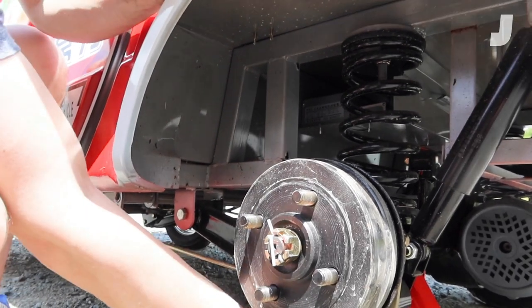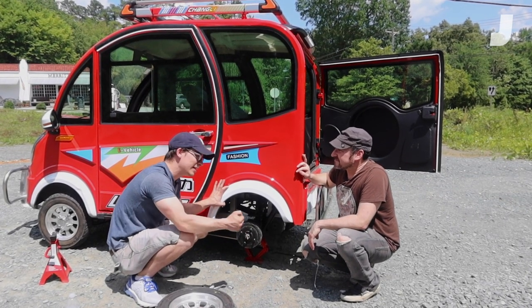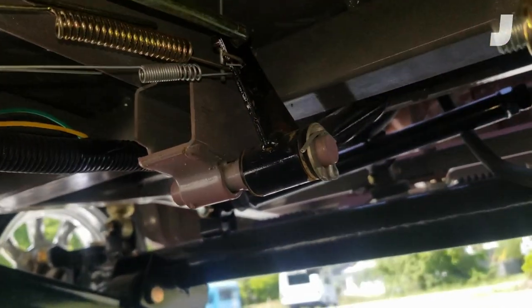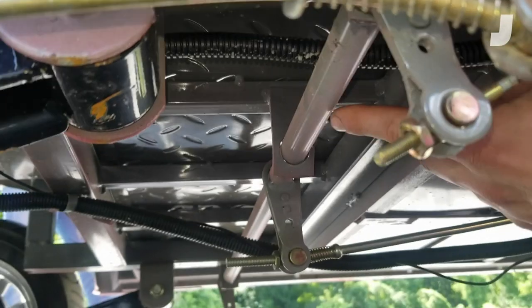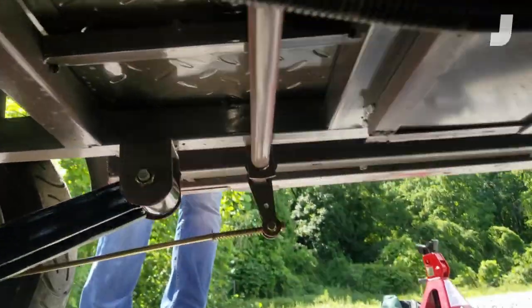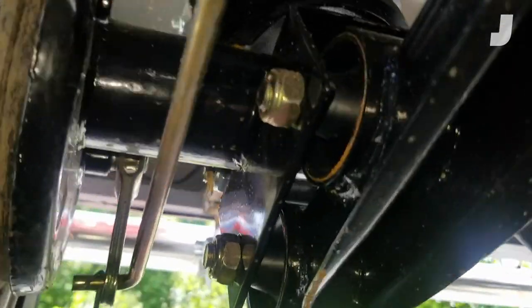We also have a brake. This is a cable-driven system — so when you press that brake pedal, you're pulling the cable, literally just like pulling the handbrake. Press the brake pedal there, Jason. You can see there's the brake pedal being pressed straight down. There's a little bell crank that pulls this rod, and that pulls this big huge rod that goes across the whole vehicle, which then pulls the rod that activates the rod going into the drum brake. It's pretty great.